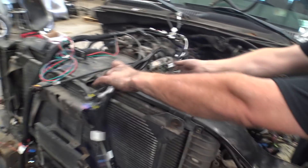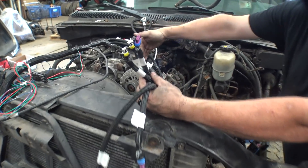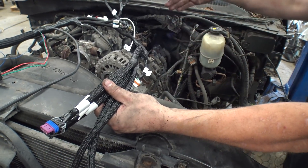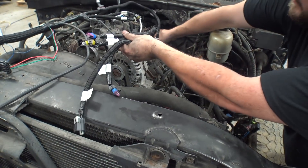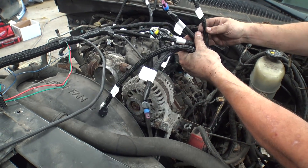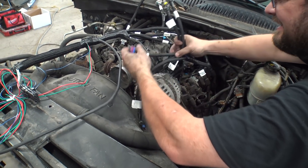It's easy to tell because they purposely set the harness up like this because this is where idle air control and throttle position are. Everything's on this side of the motor. So this is the ignition harness for this side - it says ignition odd, but this is one, three, five, seven. This guy goes right into the coil pack harness and then we got to attach this guy to the back of the head. Those are going to be the difficult things. You just take these and go TPS - plug it in, click.